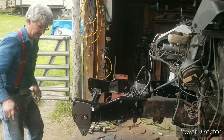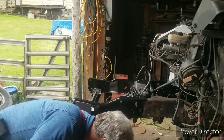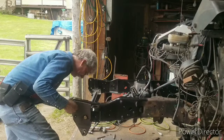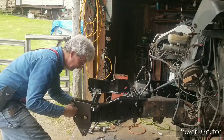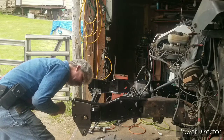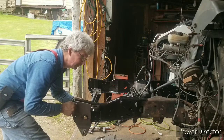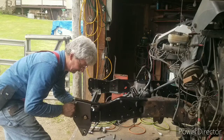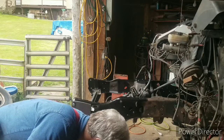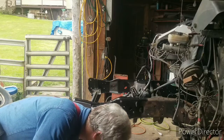All right, 1/2-inch bolts. Inch flat washers. These holes are slotted on the inside. You know why they did that? It's because that's where the bumper mounts. They want to be able to move the bumper around to make the mud lines line up. Now we're going to do something different for a bumper. So, we're using them to mount the springs.